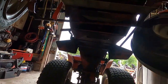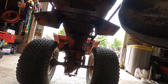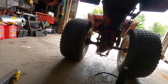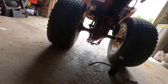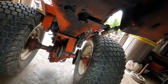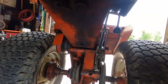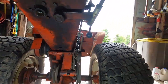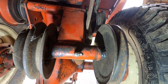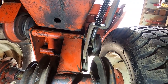I'm going ahead and lubing these points while I've got the tractor up on the lift. Here you can see the grease zerk a little better on the mid PTO, and then those pivot points. Now we're going to move to the back of the tractor — I already mentioned the grease zerk on the differential.